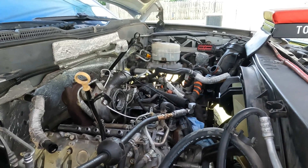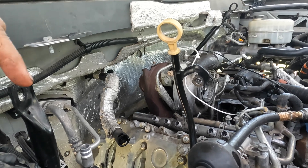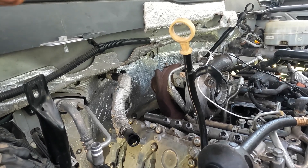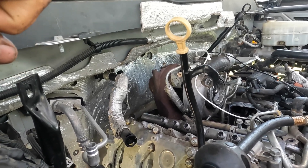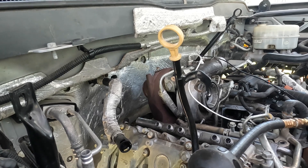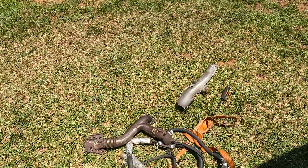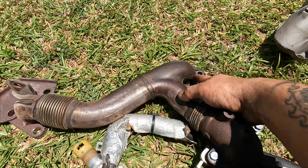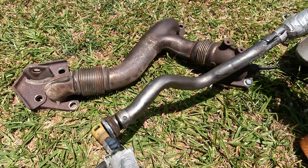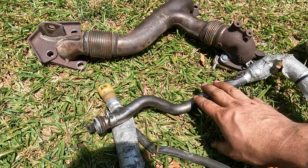It is pretty warm here in South Carolina. What I've already done today was remove the feed line from the exhaust manifold to the turbo, then pulled the heat shield off on the driver's side from the same pipe, and unbolted it from the exhaust manifold. Both of these are held in with six 13 millimeter hex socket bolts. To get this off I did have to take this EGR coolant pipe off. We're going to try to get a block off plate for this one because it isn't needed anymore and we can actually bypass all this.